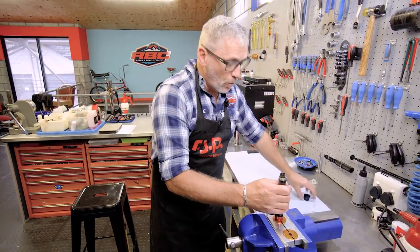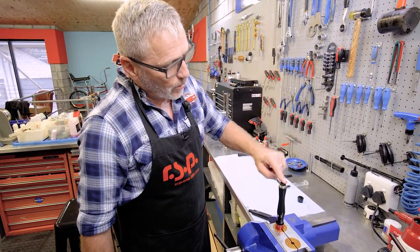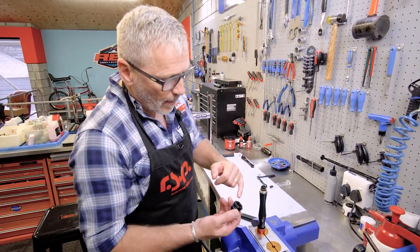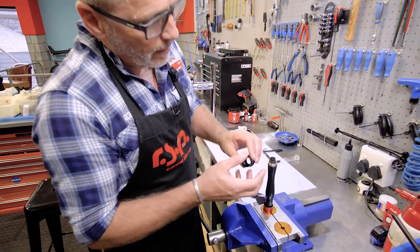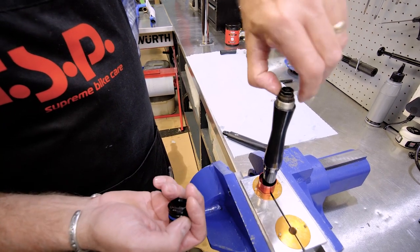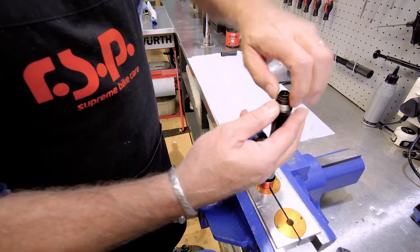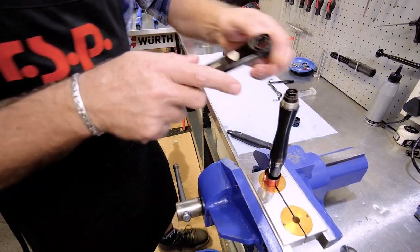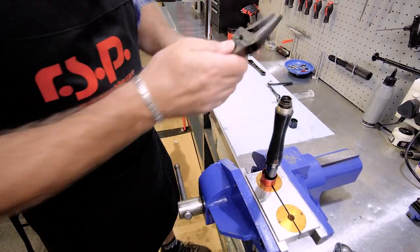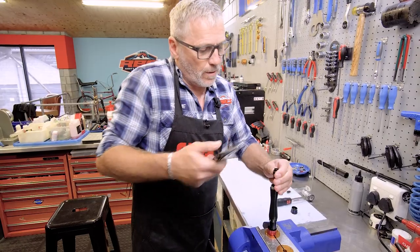Okay, there we got our top cap off. Now we've got our charger damper's actuator, so we can open this and see. So just a quick heads up on this. There is no seals in here, and there's no seals around here. So what tends to happen is if you're racing, or if you're riding in muddy conditions, or even if you jet wash your bike, you will tend to see that the water does collect in here. And that causes some problems with the spring. There we go.